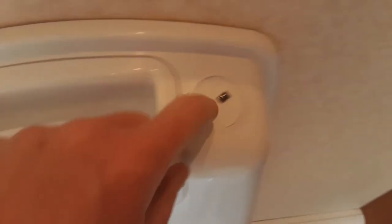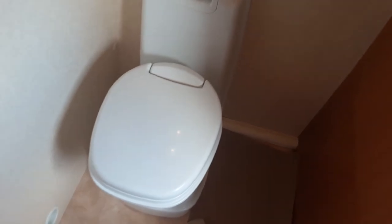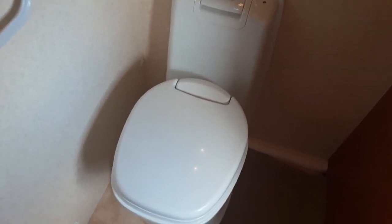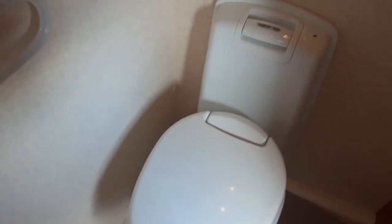The toilet system has a pump flush on top to pump the toilet up and down. There is a full indicator light — when the toilet waste cassette is full, it will illuminate red. At the front of the toilet you have the waste handle which you pull across to allow the toilet waste to go into the cassette under the van. The toilet seat does turn for your convenience — it will spin either direction. However, when removing the cassette from underneath the van, you need to make sure it's pointing straight across towards the shower, otherwise the lockout tabs will prevent cassette removal and you'll end up with a mess in the toilet cassette locker.